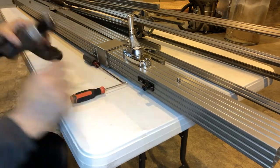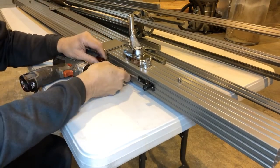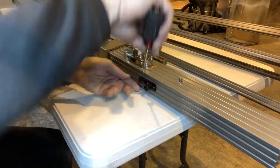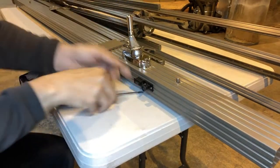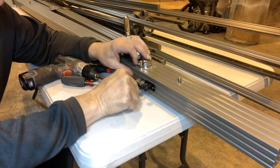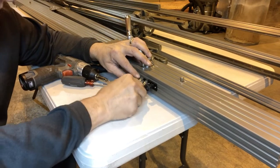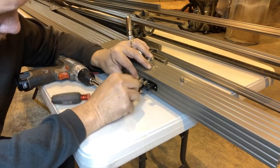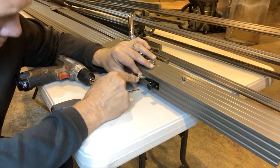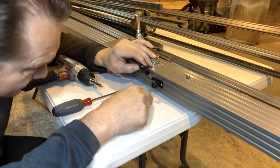So to check here, I'll just start here and pop this light switch out with a flat screwdriver. It pops out pretty easily. It has three wires on the back of it. And as you can see on this one, one of those wires popped off. So the light problem with this umbrella is right there. All we have to do is pull that wire through and pop it back on. It's the red wire that goes to the socket.